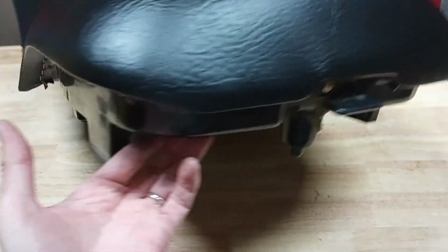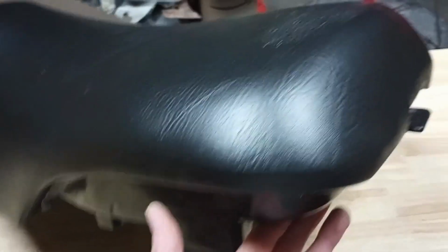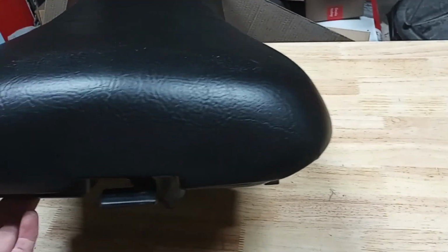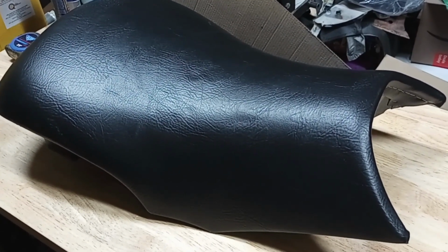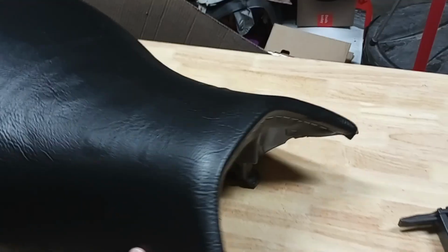And what that looks like on the back is a perfectly round corner, and make sure you use plenty of heat. Don't forget that heat is your friend when you're doing vinyl work. It will help it to stay soft and pliable. Now, this is the finished image of it. Nothing to it, really. Take your time with it and just make sure your staples are embedded in there.